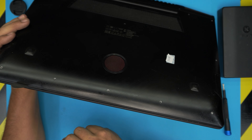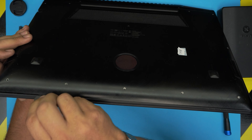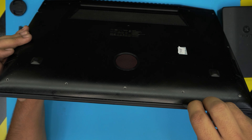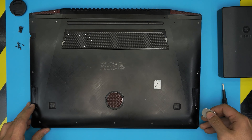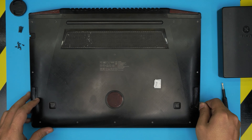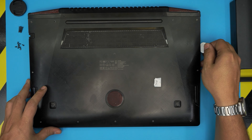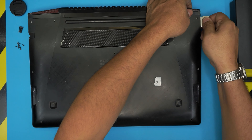At the bottom of the laptop, start removing all the screws. There are two types: long screws and short ones. In my case there are some different-colored screws because the client lost a few. The longest screws — these four near each other at the back — are the only long ones. Remove the long screws first and keep them in one pile so you don't mismatch them with the rest.